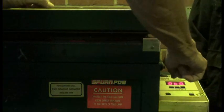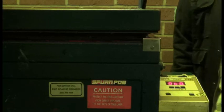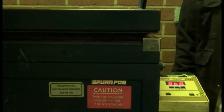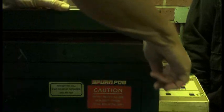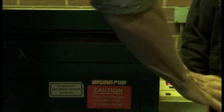And so sometimes you'll notice when it's counting down, it'll go kind of normally, and then it'll start going real slow at the end. That usually means the bulb's wearing out and it's kind of, you know, dragging itself a little bit to make sure enough light gets on the screen. Then that just shuts itself off. You don't have to do anything else there. All you really have to do is on and off, but you don't have to set the time.